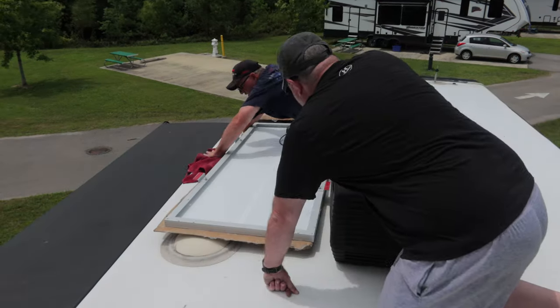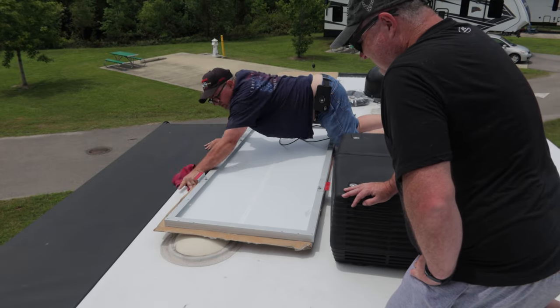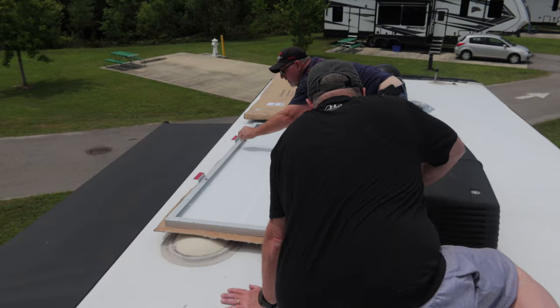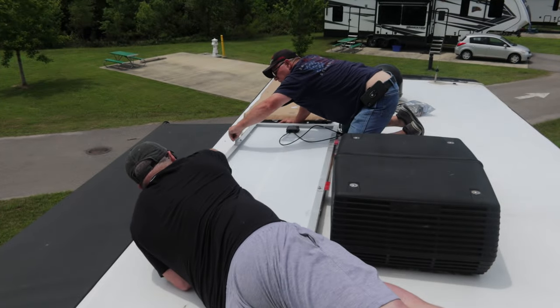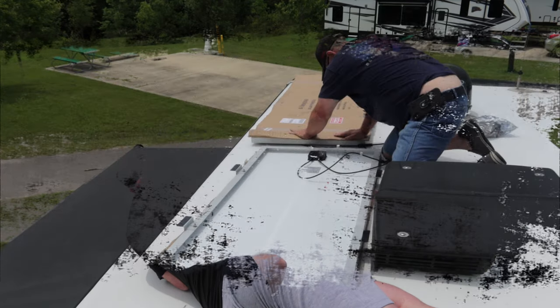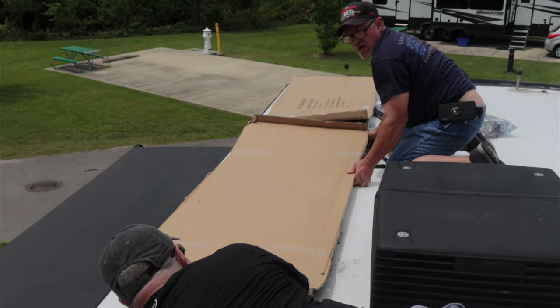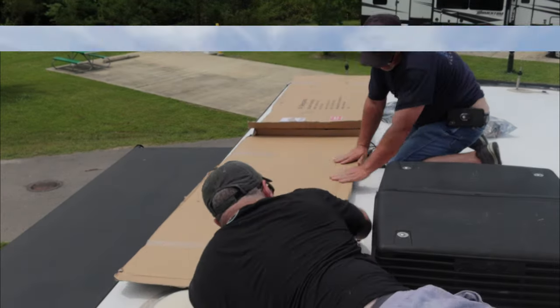The wind really messed up the audio here. Mel is wiping down the roof surface with alcohol to make sure it's clean and dry, then we'll pull off the tape backing and stick the panel down. You have to be really careful because once you place it, it's not moving. We're being careful to line it up and avoid covering a vent. We did run into a small issue — the wire loom we have is too small, so we'll buy a bigger one. No big deal, though, since the wire loom has a slit down the side and we can run the wires now and add the loom over them later.